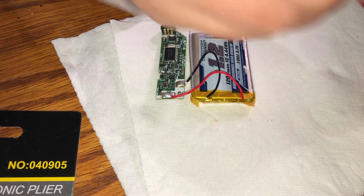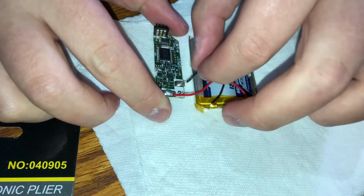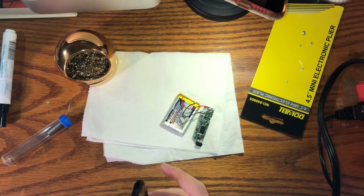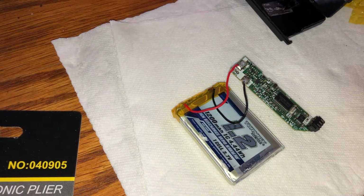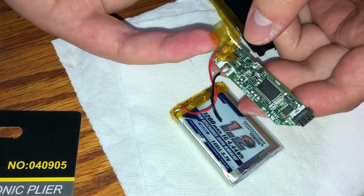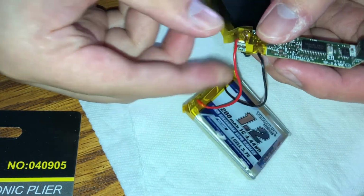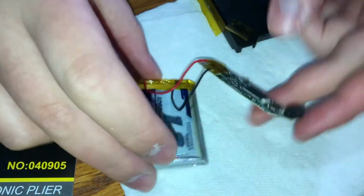So I'm going to clean my soldering iron tip, and now I'm going to pull on the wires to make sure the solder joints are nice and good and everything feels good. So I'm going to grab my battery shell and start making preparations to fit the battery cell and the PCB inside the shell. And I'll be using Kapton tape to cover up the PCB, like where the wire connects to the PCB. And after I'm done taping all the solder points, I'm going to transition back into the original video in 3, 2, 1.